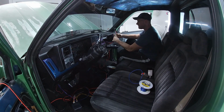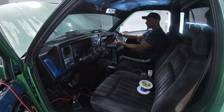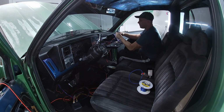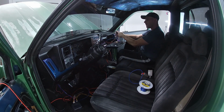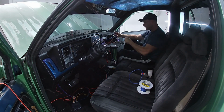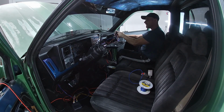As far as the other wires, I think they also have a switch wired in, which is the exact same thing. If you wire your switch into the trigger, so your trigger wires are your black wires on here. So pin 85, if you jump pin 85, pin 85 is going into the relay. So if you jump pin 85 and throw power to that, it's the equivalent of hitting the button on your remote. It'll send a signal, not through there, but it'll send a signal of power right into the relay,